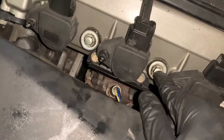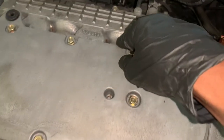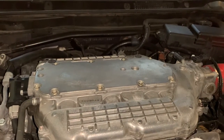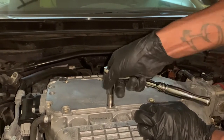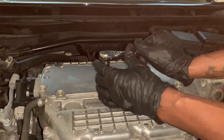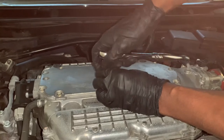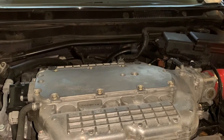This is the front gasket. I'm gonna attempt to get to the back gasket — that's where I think my leak is — but I'm also gonna change the front. Guys, you have to be very careful when putting these back on: don't over-tighten. Look how easy it comes off — I'm not even applying full force and it opens pretty easy. So when putting it back, the same thing applies — not over-tightening.